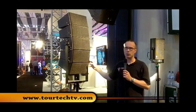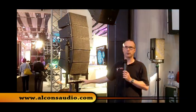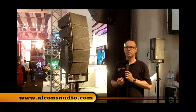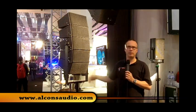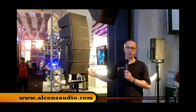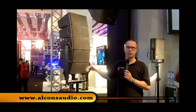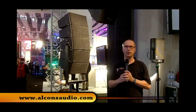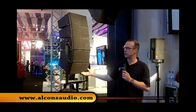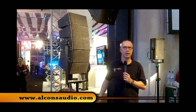And as you can see, because of the micro compact size, it's also possible to put a line array on a stick. This is something we're showing here for the first time. It's also for the first time in the industry that it's possible to put a complete curvable line array system on a stand mount, like you see here, maintaining full curvature of the array. So that means you can create either a flat wavefront, and then the vertical dispersion will be roughly between 10 to 15 degrees, or open 5 cabinets up with each 15 degree dispersion up to 75 degrees vertical dispersion, and every setting available in between. The total weight of the array in this case is 40 kilos, so stays well within the working load limit of a normal, regular, in this case, K&M stand.